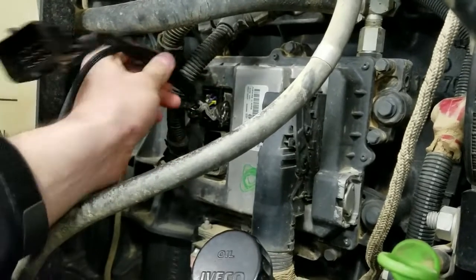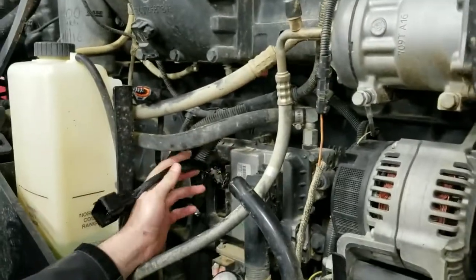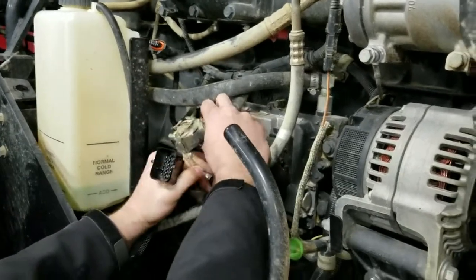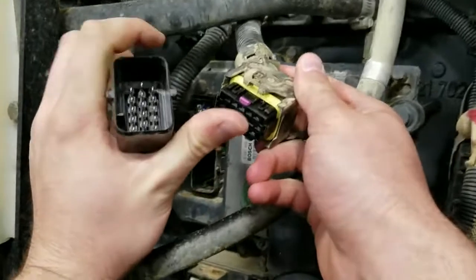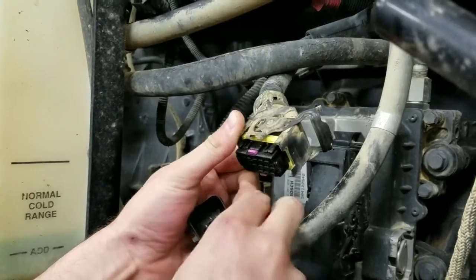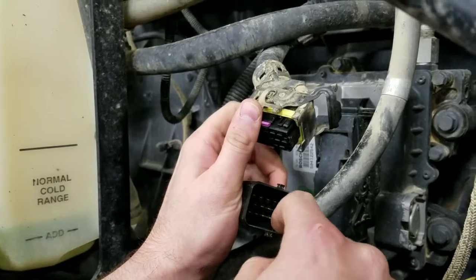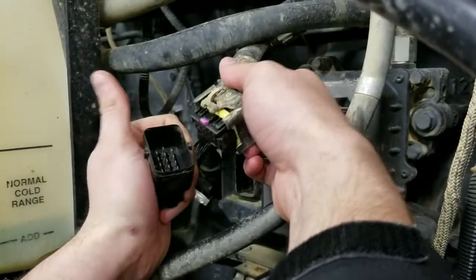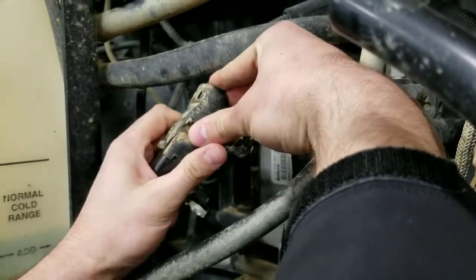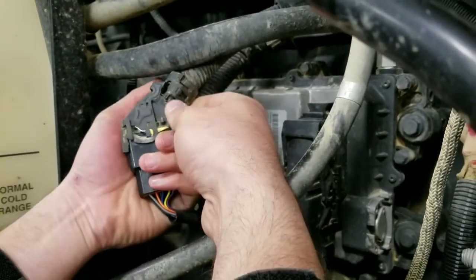The lock on our connector is actually going to be the opposite of what the factory is, but the way that we're putting it in is what is stated in your installation instructions. So once the female connector from our harness is into the ECM, we will take the factory female connector and go into our male connector. If you look on this female connector, on one side there is an indention point that lines up with the alignment tab on our harness male connector — just make sure that indention point slides right in line with that, otherwise it won't go in the opposite way. That's in — we'll go ahead and lock it now. See, that's locked fully into place.